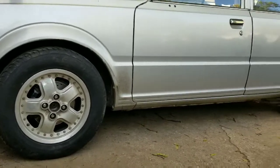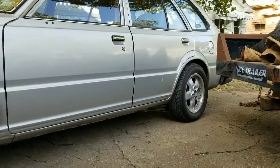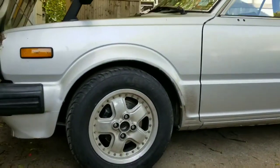Once I cut that in half around, I should be able to lower it at least half an inch to an inch, and it'll give a little rake look when the rear is lifted. Then once the rear goes down as the fuel level goes down, I can take some air out so it's even. I've only gone about a block but the ride quality is so different. The back is really bouncing because it's at 70 psi, which is what most people run at full load.